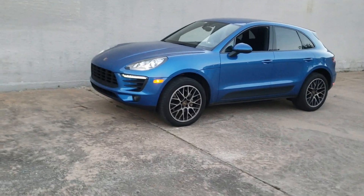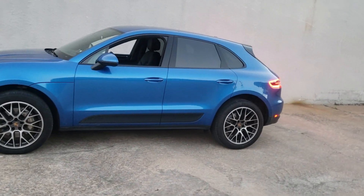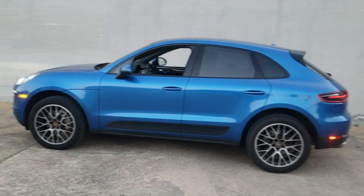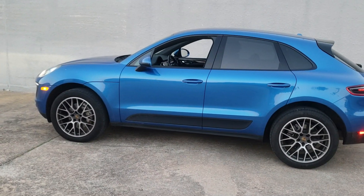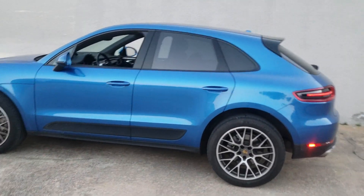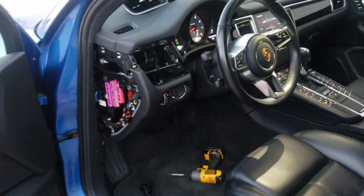You'll see parking light confirmation. Give it a few seconds, you'll see the brake lights kick on, and then the car will crank. There we go. Hit the unlock button, and now we have 45 seconds to get in and perform our secure takeover. If you guys exceed the 45-second window, the remote start will turn off when you open the door. Hit unlock, go ahead and open the door — the car stays running.